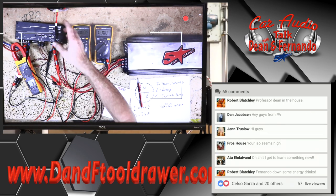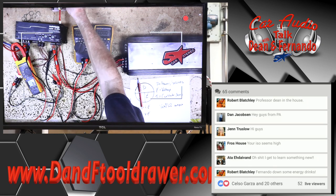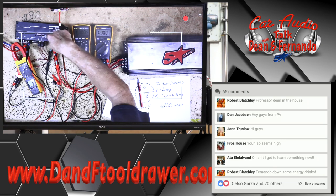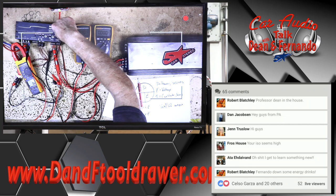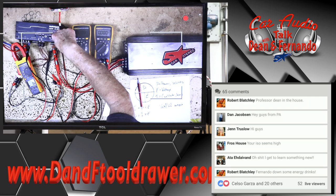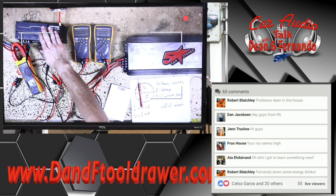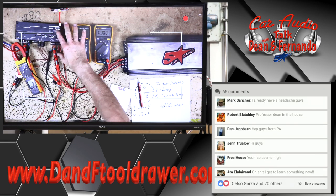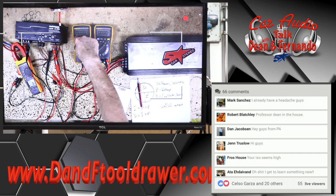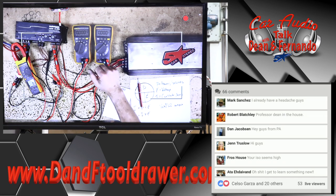To do this, we're going to use the phone over here to play a test tone — 1,000 hertz coming into the amplifier. We've already gone ahead and set the gains on the amplifier for clip. This Audio Control ACM amplifier has two clip lights on it, so we know we're good there. We're going to turn on our 50-amp power supply to power this whole thing up and take all four of these readings. The fourth one we already know, which is 4-ohm.